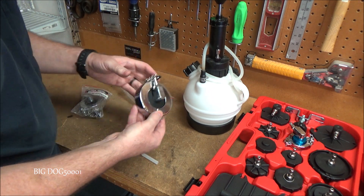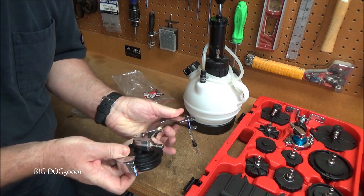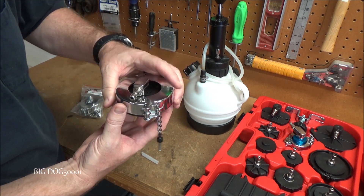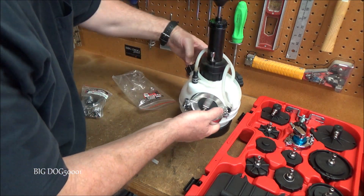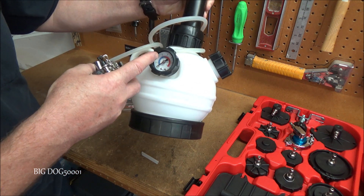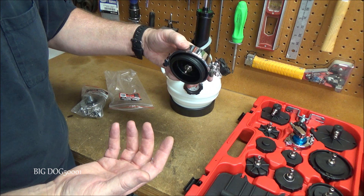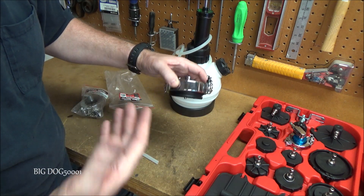You just take these — there's a pin that we can pop out right there, and then it opens up like that. We take this, press it down into your master cylinder. You can see it's got some O-rings right there. Then you seal this, and this will grab the top edge of the master cylinder. Put the pin in like that, then hook it up with our quick coupler. Pump it up — keep it in the blue there and you're fine. I just keep the brake fluid in the master cylinder. Pump this up, then go to whichever corner of the vehicle you want to bleed, crack the bleeder, put a tube on it into a container, and it'll bleed out. You can do it all by yourself, which is pretty nice.